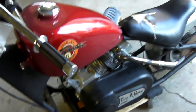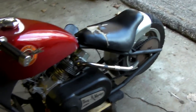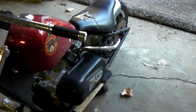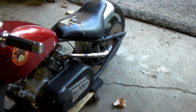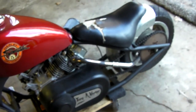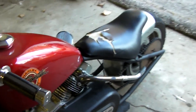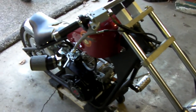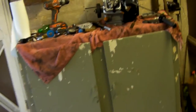It kind of used to lag because the sprocket I put on the back was so small — I had a hard time getting it up to top speed. The torque converter made a big difference in that aspect. The flywheel, the jet kit, and that little stage one mod kit definitely made it a little more beefy for sure. So I'm basically doing the same thing to this bike, this little track bike I've been tinkering with.